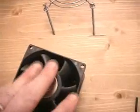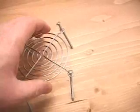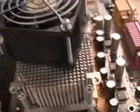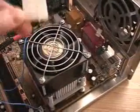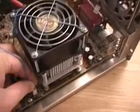The fan comes in a few parts: the fan itself, the grill, and four screws. Insert the screws through the grill, then down through the fan, and connect the fan into the cooler — the screws go down through the holes, with two on each side, affixing it securely to the top. Once finished, plug the fan directly into the power supply. There's also a sensor that plugs into the motherboard to sense the speed of the fan.